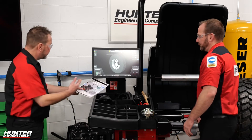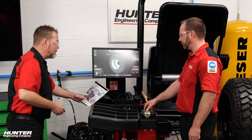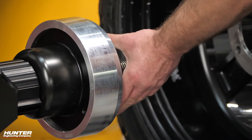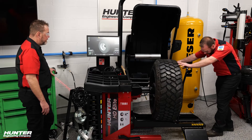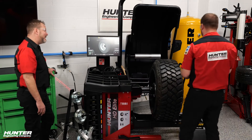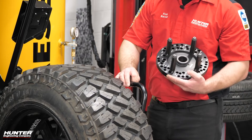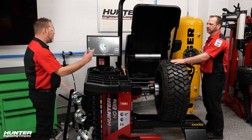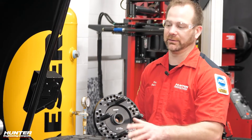If you're not sure what collet size or adapter to use, they're all hanging right there and they're numbered — so if you look up the year, make, and model and it tells you to use number 16, grab number 16 and go for it. We slide the spacer on, slide our wheel back on, adjust the wheel height, and get it centered. Our flange plate is already set up with multiple positions — we can grab these pins and use anywhere from five to eight lug positions, going right through the lug nut holes. We're actually mounting this tire just like it would sit on a vehicle, which is great because with this custom wheel, we don't want anything on the front face that could scratch it. We don't want to use a cone cup on this.